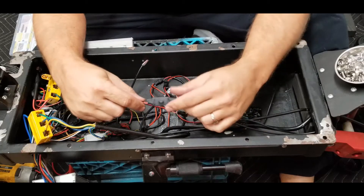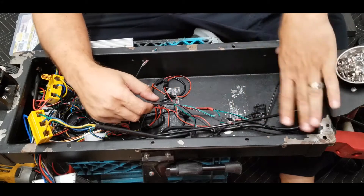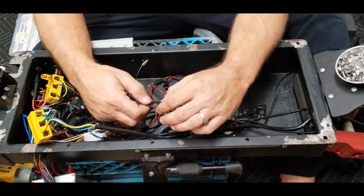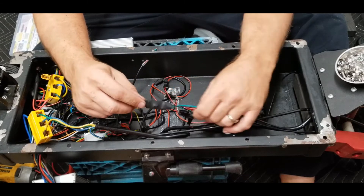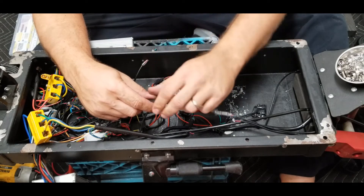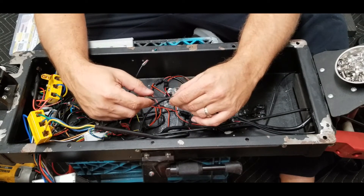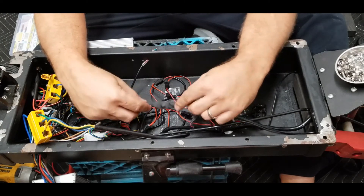Here's another DC to DC converter right here. If you're thinking about doing a lighting project, you find the voltage of your LED lights — say I wanted to upgrade my back LED lights to 12 volts. I'd find a DC to DC voltage reducer that goes from 60 volts to 12 volts, remove the old lights, remove this, solder the new ones on. Some of them come with wires already attached with connectors, a little pricier at $10 to $15, but you can set the voltage to whatever you want.